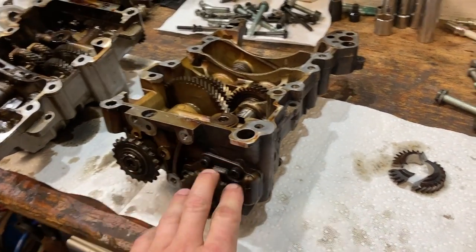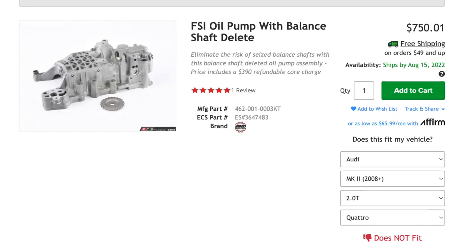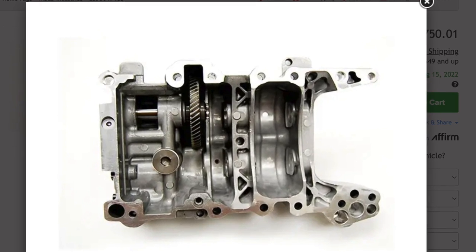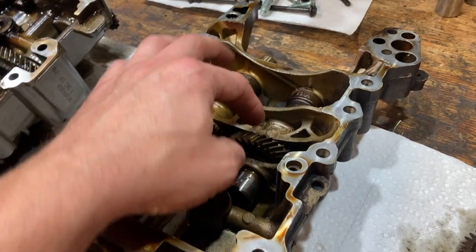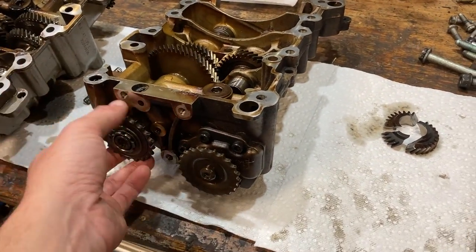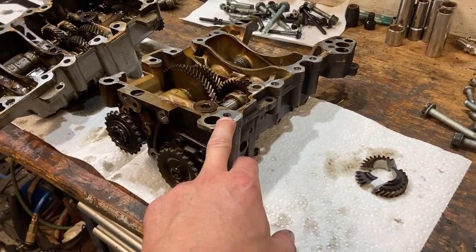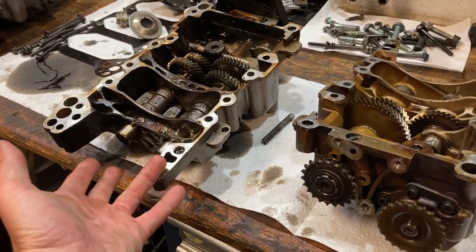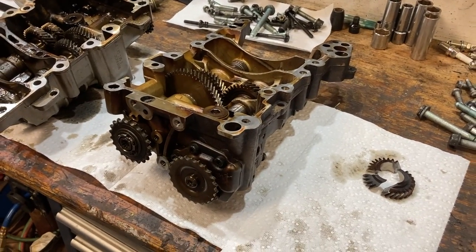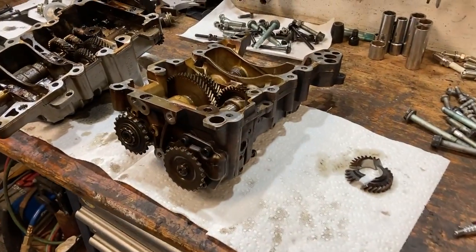Option five is the IABed oil pump. He builds them from good cores — he presses out the balance shafts, plugs the bores so your oil galleries aren't bleeding excess oil, and adds a freewheel sprocket. The problem is he only accepts good cores, so he wouldn't accept mine, making it still a $900 option for me. On top of that, I could barely find one available for sale — the listings are there but back-ordered indefinitely. So not really much of an option at this point.